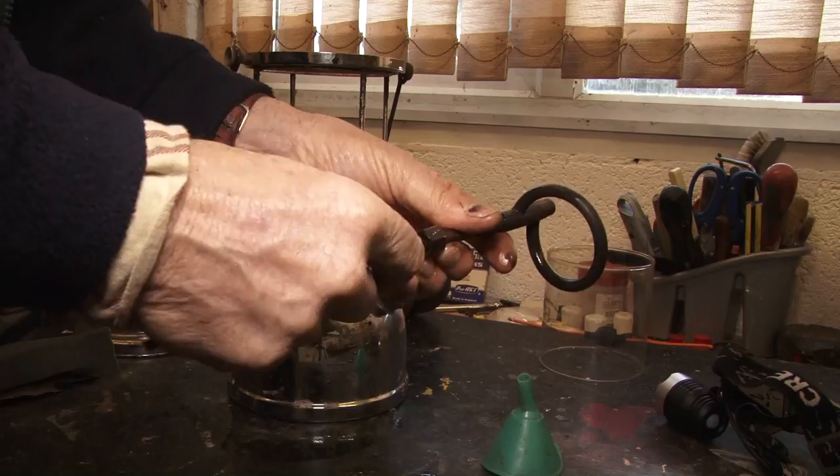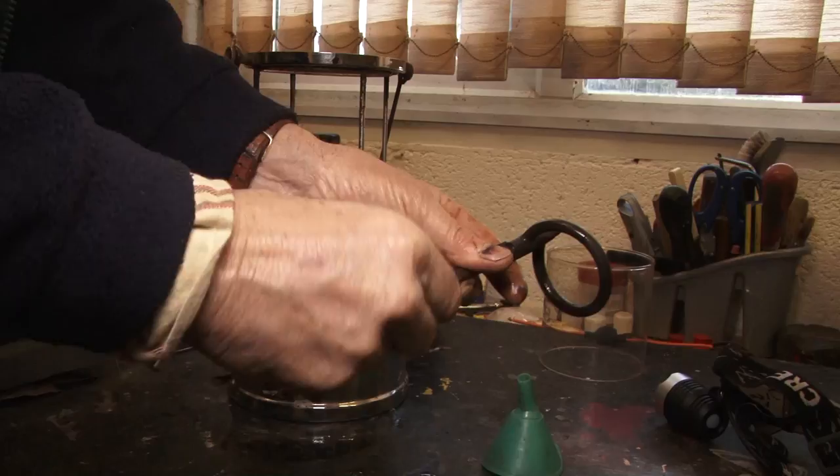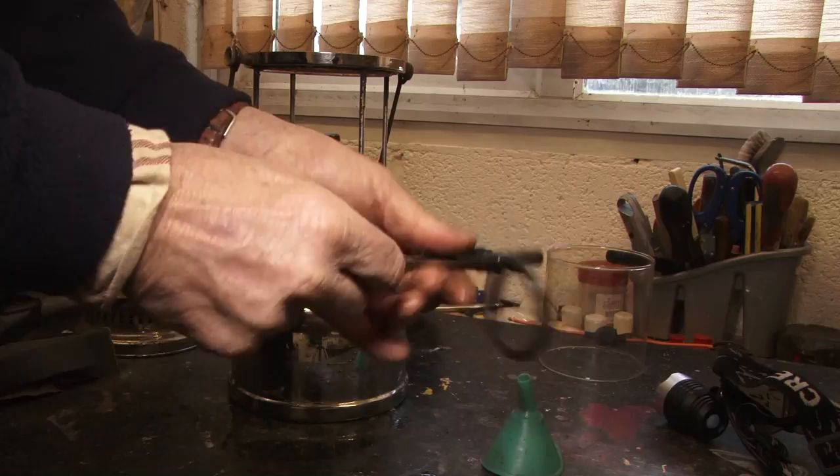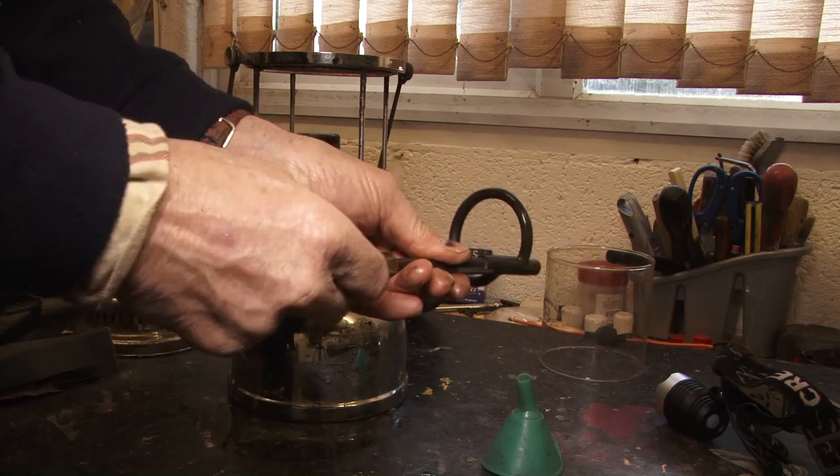I'm just showing you what to do. Get some of the carbon — look, it's black — so there's plenty of carbon in there. I'm pretty sure if we follow this procedure, as basic as it may seem, we should get this lamp going. It's not been going for years. Just clean out the worst of the carbon. Again, all these parts you can normally buy, but to be honest if you can just work away and clean them up say every fifth or sixth strip, that's all you need. Just use the end of a paintbrush to get it right up in there — spin it around, twisting it. That's pretty well clean and polished on the inside, ready to go back.